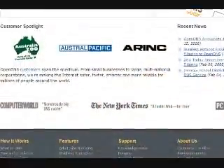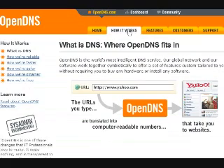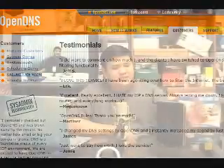The second problem is the missing DNS settings — you really can't specify them. We use several OpenDNS services at the office, which let us offload from our ISP's DNS. Having to set it manually on each computer rather than having the router automatically assign it during DHCP addressing is just lame. But other than that, the 450 is a very solid product — something we're probably going to be using quite a bit to make sure we always have internet access when on the road.